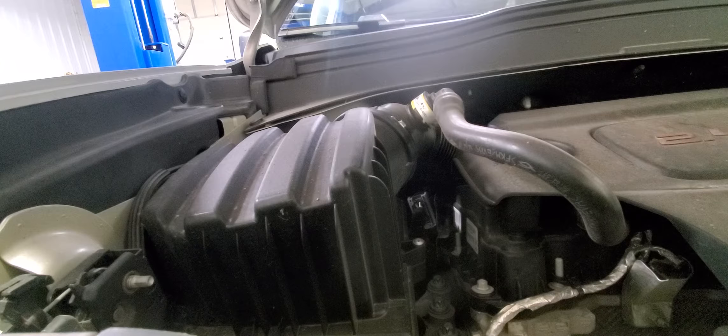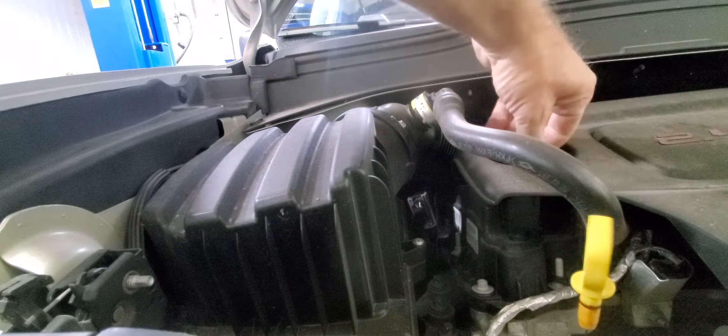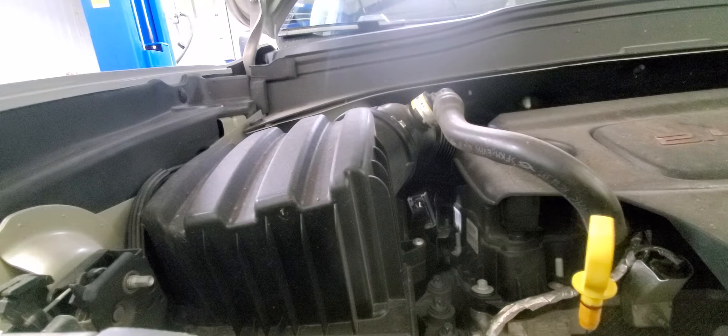I haven't drained it yet. The vehicle actually died because the intake valves are controlled by oil pressure on this vehicle — it had little oil pressure due to no oil in it. So I'm going to go ahead and change the oil and see how much actually comes out compared to what's supposed to be in it.